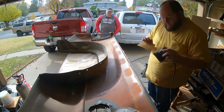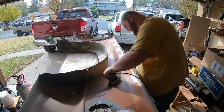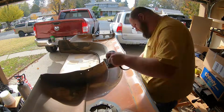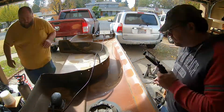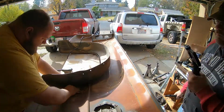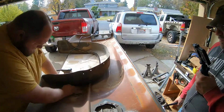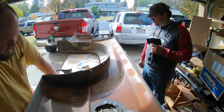There are 2 popular types of fiberglass mats. There's the chopped stranded type, and then there is the woven type. I chose to go with the woven type. Now, it provides structural rigidity in 2 directions. In order to maximize the rigidity of this particular project, we ended up cutting some strips and placed them on the form at 45 from the original layer. We ended up with 2 layers, and it didn't add a lot of weight or thickness.